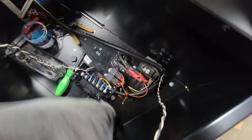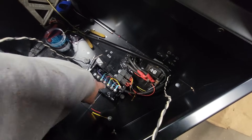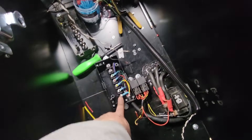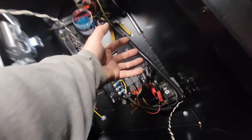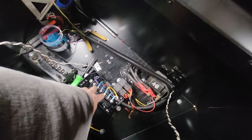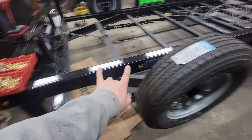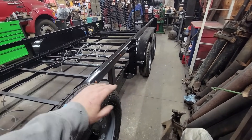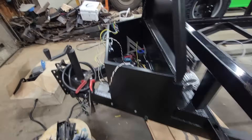I've brought my wires in from the box down below and changed that box out. I only brought in the signals we need: a ground, the backup signal from the towing vehicle, a left turn, a battery charge line, and a right turn. We need the left and right turn here so we can isolate those from the brake lights - we don't want the whole side to light up when you hit the brakes. We just want them to come on with the turn signals and marker lights.